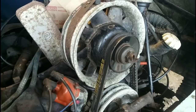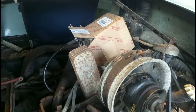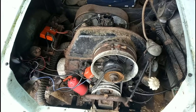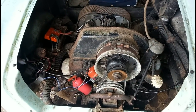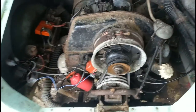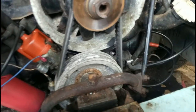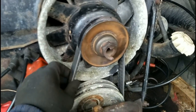That's now back tighter again, that's attached. Better give her a run. But I might just put things back together again first. Once again, I am frustrated - she doesn't want to fire up at the moment. I'm starting to think better plugs might be a good idea. I've changed the coil which improved things slightly, but she still just won't quite run. I've been through everything else on the ignition system - it's only really the plugs that I haven't changed. But at least I've got my belt tension.